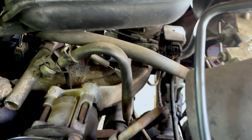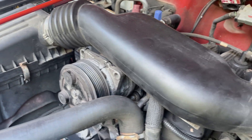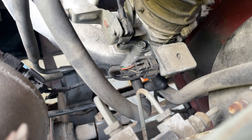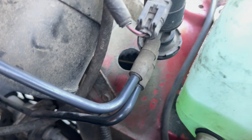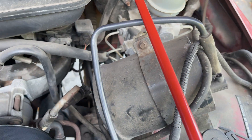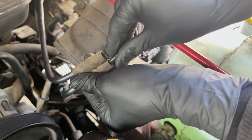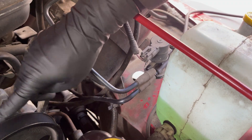Measuring the vacuum is as easy as measuring the pressure. You only need to locate the intake manifold vacuum line. To locate the intake manifold, follow the air intake and it will lead you straight to it. The air intake leads air directly to the intake manifold, which in turn is connected to the engine. Somewhere on the intake manifold, you'll find a rubber vacuum line, which sometimes leads to a large soup-can-shaped cylinder, which is the vacuum reservoir. The setup will look different depending on the make and model of your car. Carefully disconnect it and attach the gauge to that line, using one of the adapters to connect to the vacuum line — just push it in and attach the rubber line going to the gauge. Make sure nothing is in the way of the moving belt and pulleys.